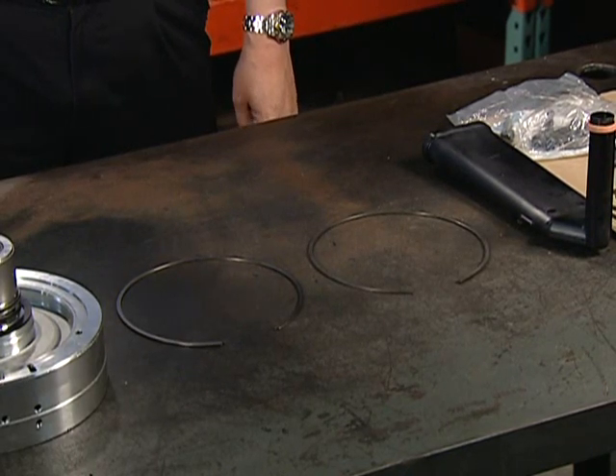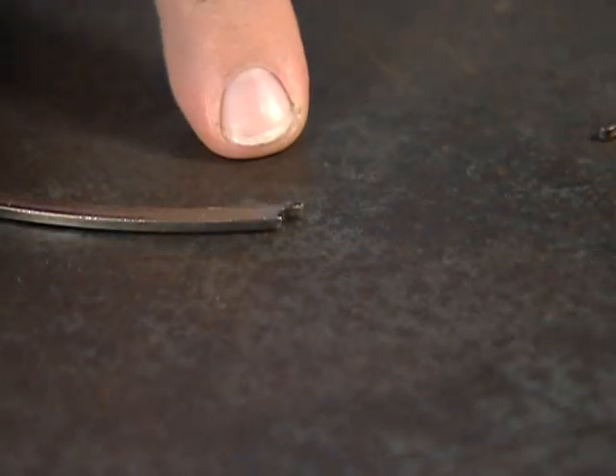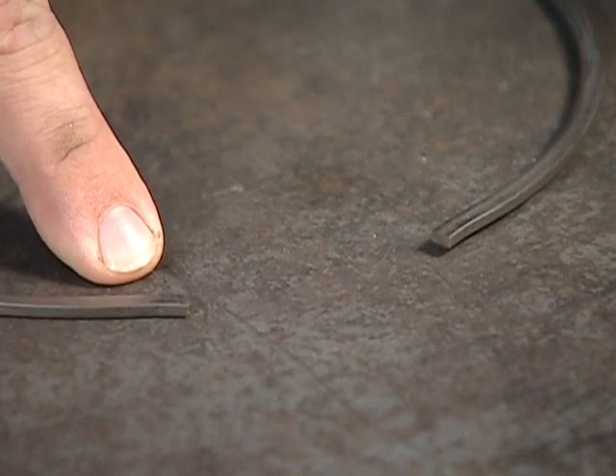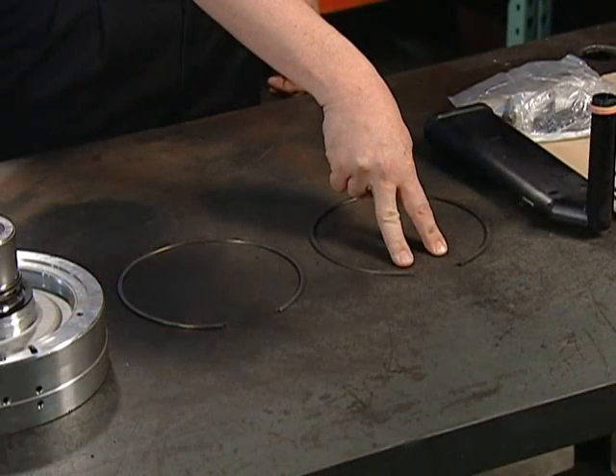This retaining snap ring has had three different designs: the first a flat snap ring, the second design had one bent tab, and the third design comes with two bent tabs, also in two different versions — waved for gas models and flat for diesel models.